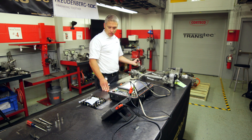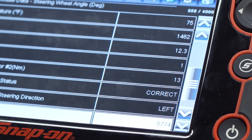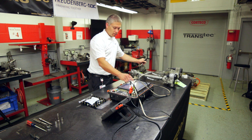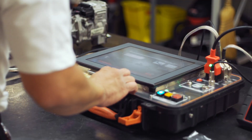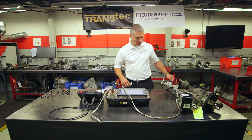As you can see on the display screen, there are normal battery voltage values, acceptable engine RPMs when changing vehicle speeds, and acceptable ECU internal temperature. However, amps are now near a constant zero, and many of the torque sensor values are unresponsive. Based on this information and the DTCs provided by the diagnostic tool, we determine that the torque sensor is defective.